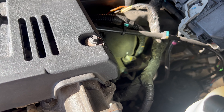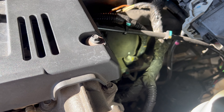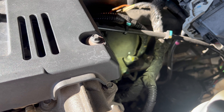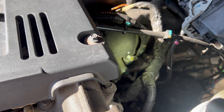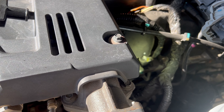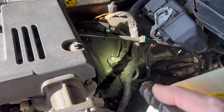And that's where the problem is. If you reach down and do what they call a jiggle test — and I've got a video on this already — if you shake that and it's loose, you've got a problem and you don't want to run that engine until you get it fixed. Because that bolt could drop off into the intake manifold, get into one of the cylinders, and you'll have a ruined engine. It's too bad that RAM hadn't addressed this. There's been quite a few over the years — I've had people go out and do the jiggle test after watching a video and find out that sure as hell theirs is loose.